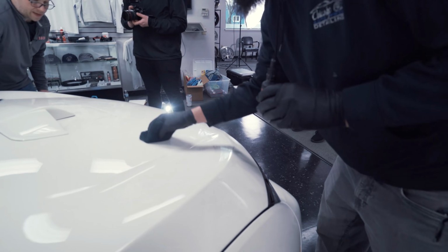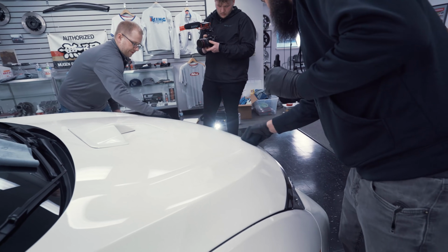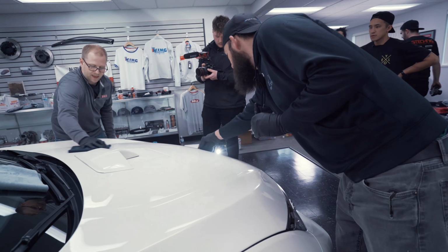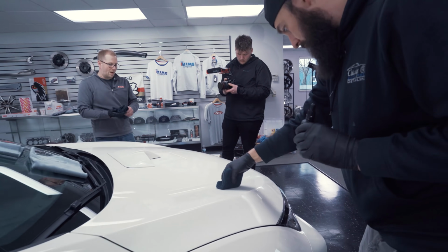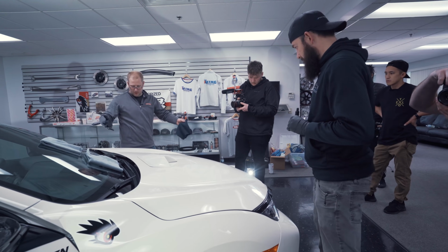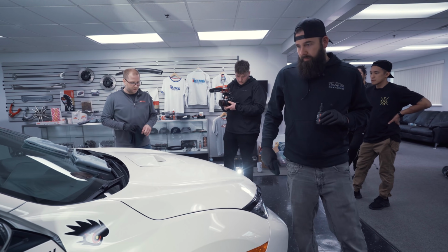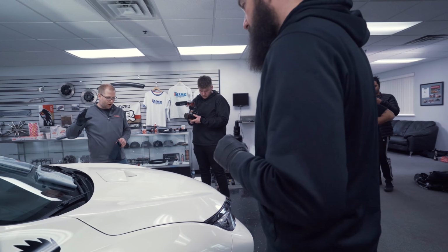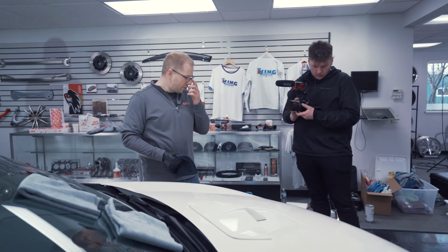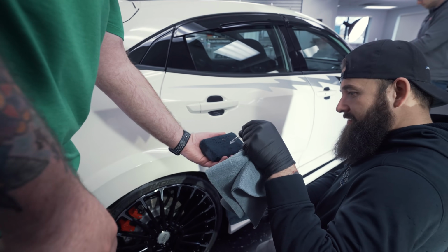It's recommended to use a 3-towel method. One for your initial wipe to take off the excess solvent carrier. The second towel is to wipe off all the additional residue and get the panel looking correct or proper. And then the third towel is what they call the haze buster. It's pretty much just done to make sure that all of the smudgy, oily residue, or what looks to be oily residue, is removed completely and that there's no haze on the surface before the coating sits to cure.